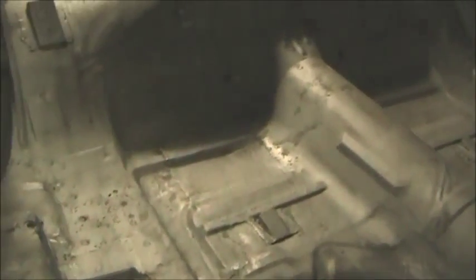Firewall has a couple patches on it but it's all fixed up. Put two full floor pans in — both driver and passenger — and took the seat risers out of a coupe and modified them so they fit for the fastback, because they are different. Couple patches in the rear floors too.